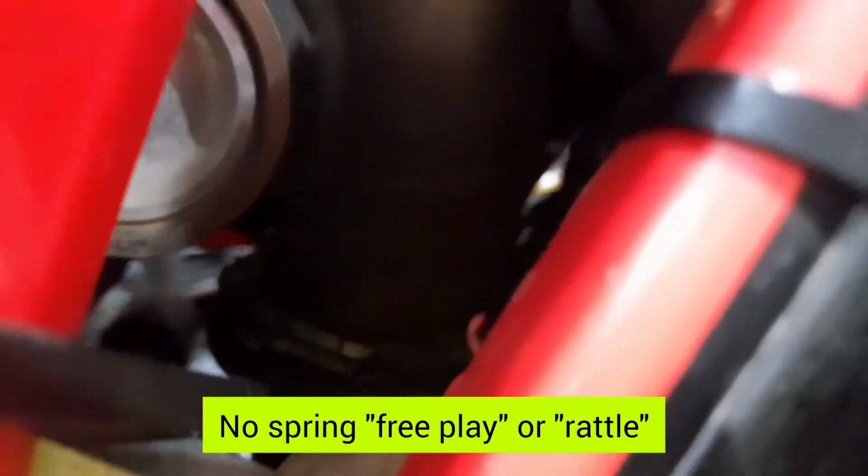And then once you're done with your adjustment, make sure that you tighten down the top ring clockwise and knock it on until it's seated firmly. Remember, don't damage anything when you knock on it. And then you're done with the rear suspension adjustment.